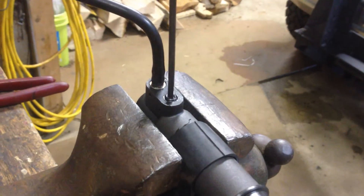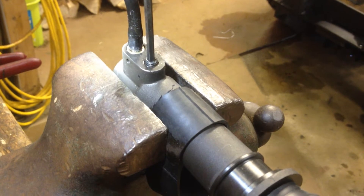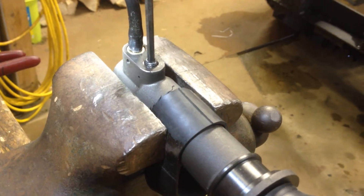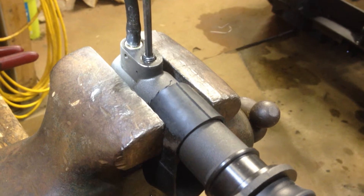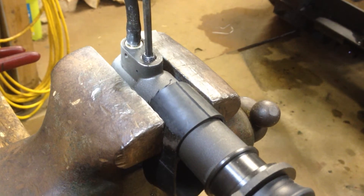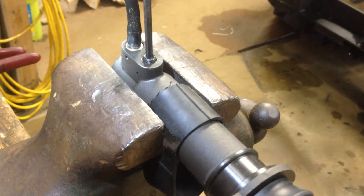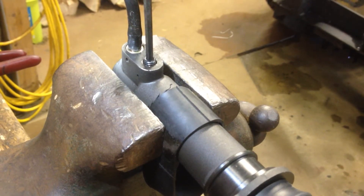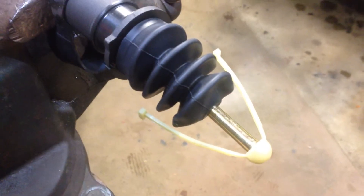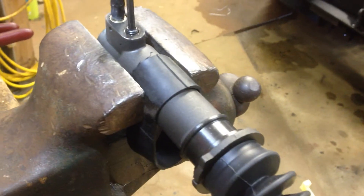Let's see now. I'm going to crack the bleeder here. We'll see what we get. I wonder how long it's going to take. It's going to fill up the whole reservoir. They said to disconnect those tiebacks for installation, so that you fill the whole cylinder nice and evenly.